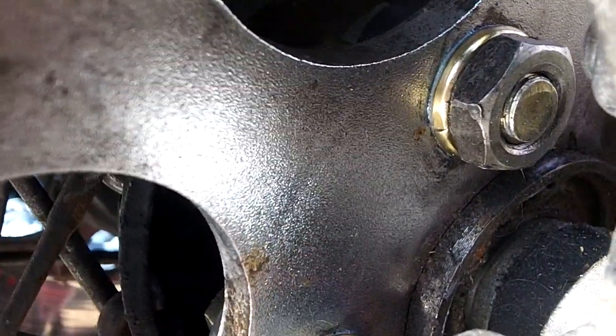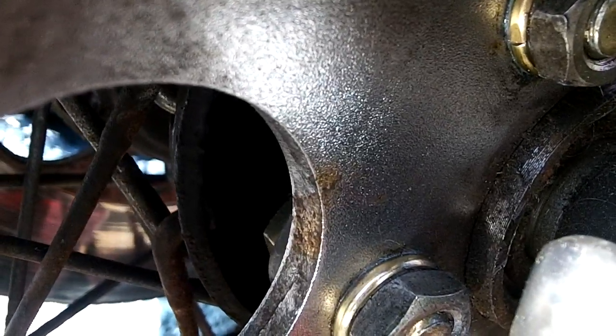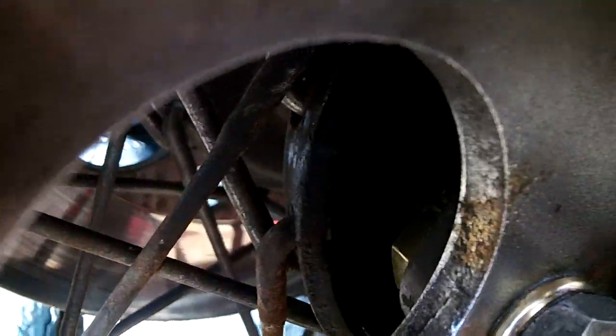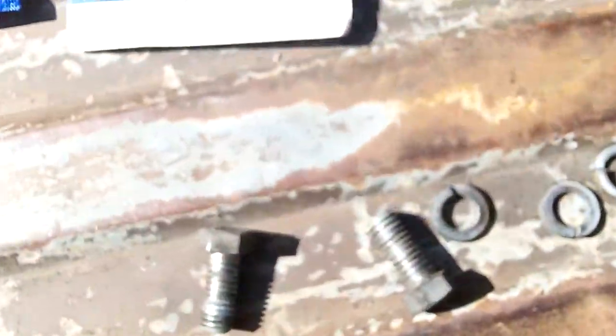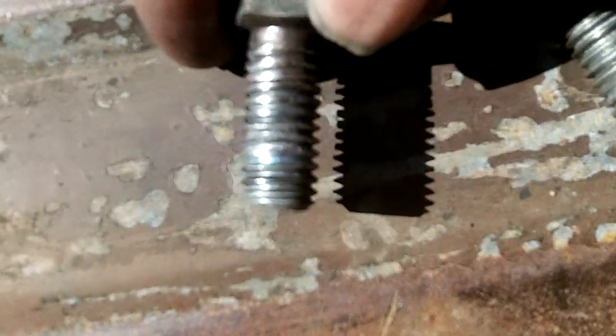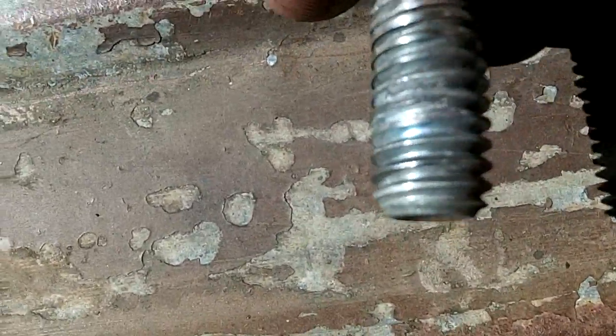You can see fresh lock washers. I reuse the nuts because they're a shallow design — they don't really want anything hanging up because you've got your swing arm right here. Those bolts were all in backwards, every single one of them. Somebody didn't know what they were doing and weren't concerned for safety. You can see how torn up these bolts are — the part had been wriggling back and forth for some time.